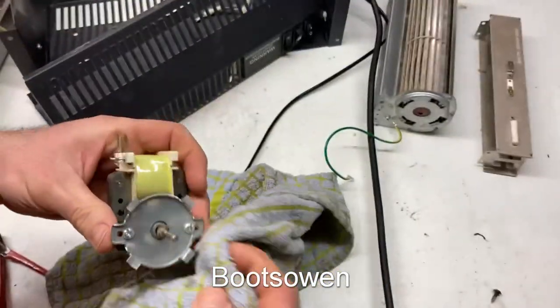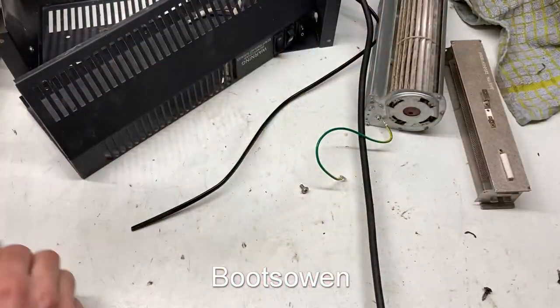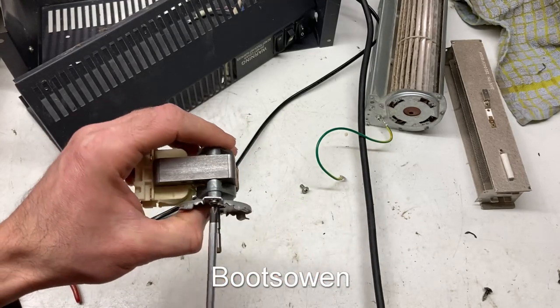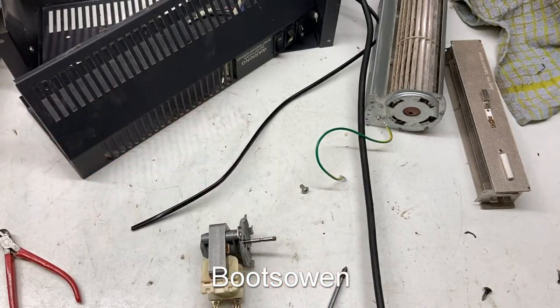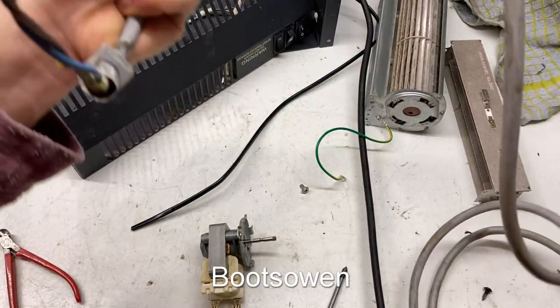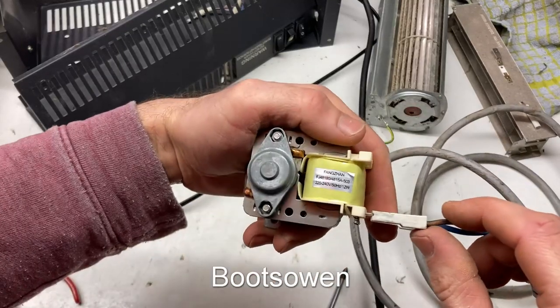Let's give this a quick wipe. This could be a very simple fix. I can't tell if it needs oiling yet — it's so easy to take apart that it won't hurt to oil it. There's a nut in there, there's no nut in here, so even if I get one side cinched up it might be a start to getting it working. The old death-to-fire washing machine cord with no safety on it — a cord you can just plug in live and neutral. I don't think it matters which way around they go because it's a shaded pole induction motor and a mighty small one at that — 12 watts.